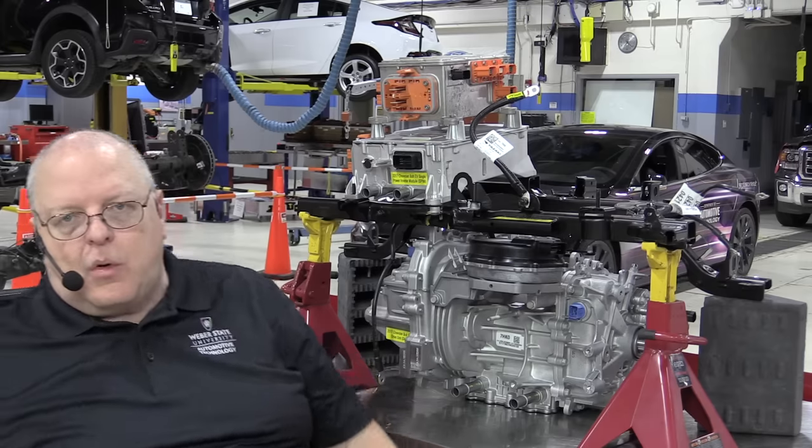By the way, none of these systems have live voltage on them — the battery that has all the power is over next to the Bolt EV. All of these wires, even though they're orange, have no voltage on them and there's no danger when you've got these components off to the side and they've been verified safe. On the back of the Single Power Inverter Module we have the three-phase UVW cables that come down to the drive unit electrical connector and bolt in place with weathertight seals. These are the only three-phase AC voltage cables on this vehicle — all others are two-wire DC voltage. If you see three wires going to a motor, those are AC; if you see two wires, those are high voltage DC.